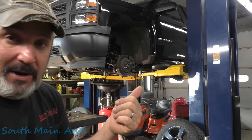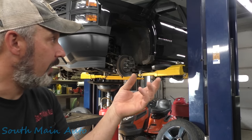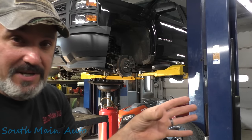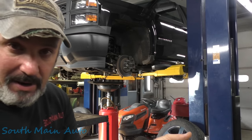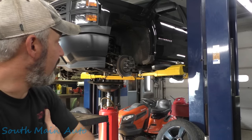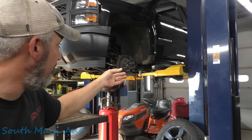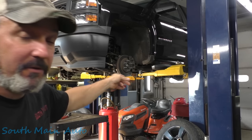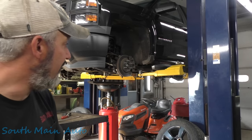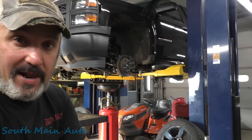The difference between my customers' vehicles who fluid film them, or oil spray them rather, just a generic term, and my customers who don't, it's night and day difference. I mean, it's not even a comparison. The people that don't, a 2015 Chevy Silverado would be heading for the crusher. Most of these have rear cross members rotted out of them. Where we put the lift up here on the front part of the frame, where it starts to come up over the front wheel arch, are rotted out there. And then particularly beside the muffler, with the factory muffler beside the gas tank, the whole inside of the frames are rotted out of them there.